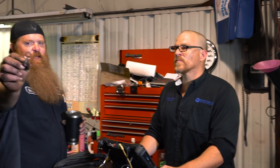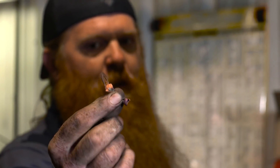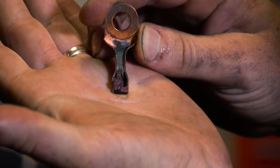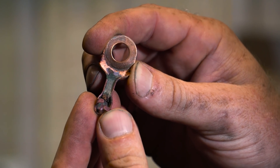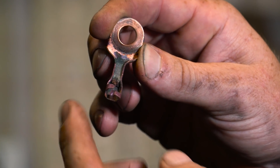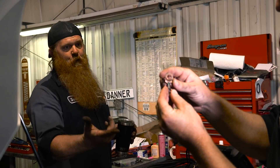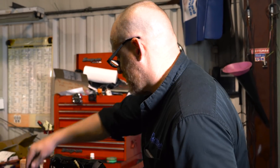GM should not be doing this kind of ground, because they crimp the plastic and the rubber, and then they solder all the wires into that joint. You can see there's no wires left — it breaks right after that crimp that's holding the insulation, and then you have all these loose wires in that terminal. It looks good because it's solid and still crimped, but all four wires broke. We saw the same thing on a Cobalt with a trans code.